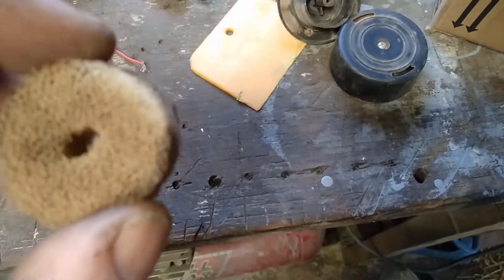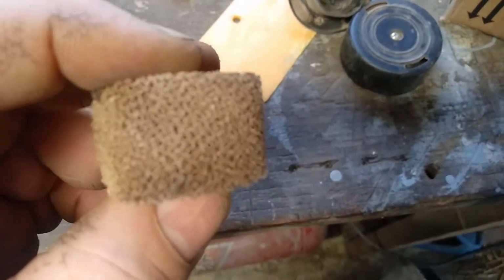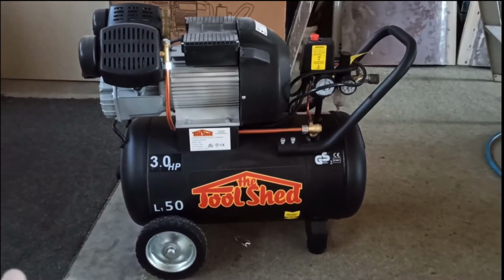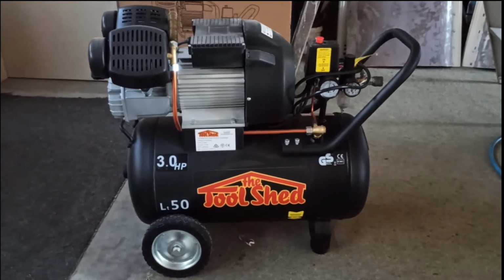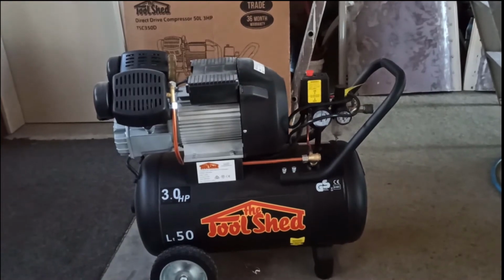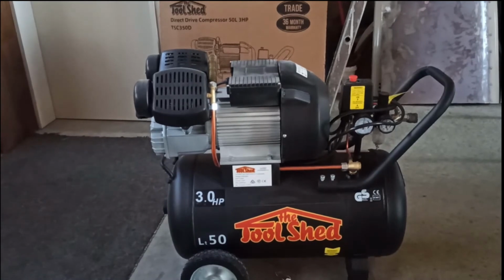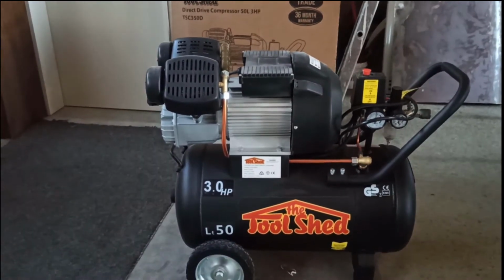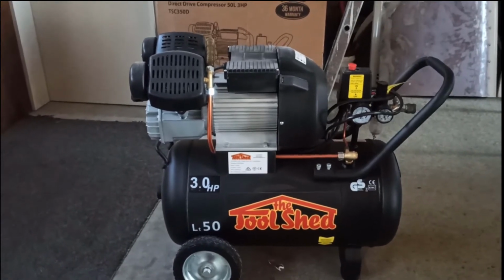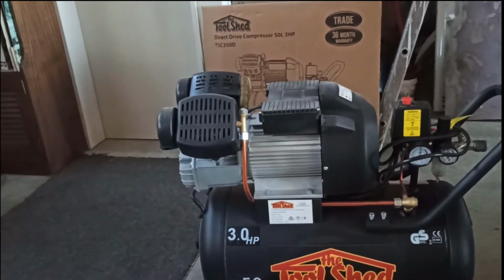But I was sandblasting underneath the bottom of my car off and on, and the rest of the time I was doing a little bit of spraying and using a DA off it. I had an extra air tank part way through, but it started wheezing and blowing oil through the lines, and I think it was mainly because it had poor filters. They were quite open, gauzy things, like something I've seen in a fish tank, to be honest. But these are a nice little soft foam filter, so I think you shouldn't have any problems with them.